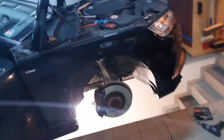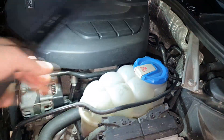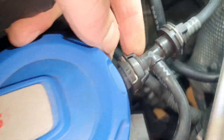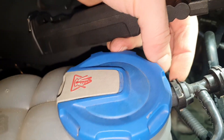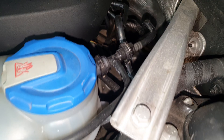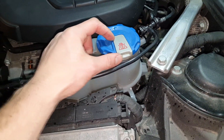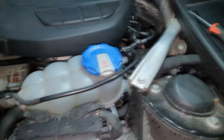This took me a while but I finally got it up in the air and the wheels detached. The instruction manual calls for disconnecting this part from the coolant reservoir and this connector over here — use a flat head screwdriver to pull this metal clip in the engine direction and then take it to the driver's side. I got the coolant line off; I had to open this because there was some vacuum, and it's off right now.